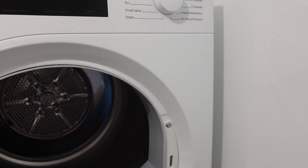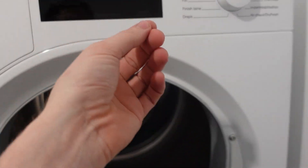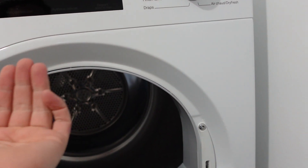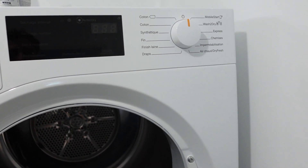If it doesn't get rid of the error, it's because your interface control probably has some damage behind it, so it thinks the button is pushed when it isn't. At that point, you'll just need to actually replace the interface control.